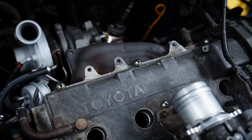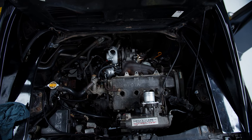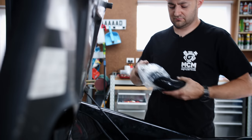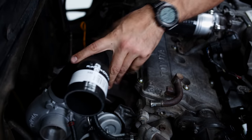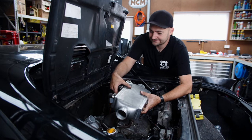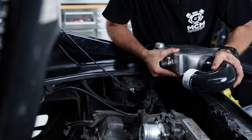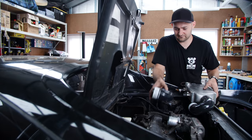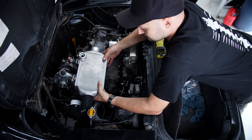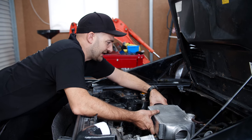The mission is to get hot air from the outlet of the turbo over to the throttle body via the intercooler. It needs to clear the bonnet, it can't rub on anything, I'll need to put mounts on it, and I'll need to mix and match joiners to make it fit. There's a bit of trial and error involved and lots of staring to try and visualise how it's all going to work. It's also a good idea to measure everything — something I didn't quite do enough of. As soon as you go down this path everything is custom, as nothing is in the stock location, so the original rubber bends probably won't work. Luckily you can get silicone joiners in all sorts of shapes and sizes. I've seen some really creative and interesting ways that people have done water-to-air on these kind of cars.